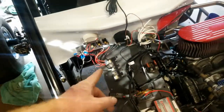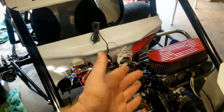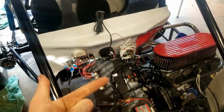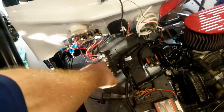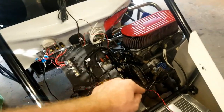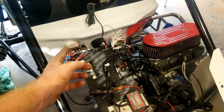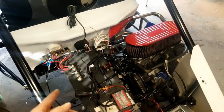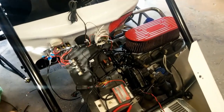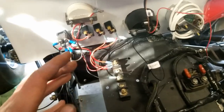If I lose everything — if I lose the motor and all my gauges go out — I either lost my main power or my main ground, and the quickest way to find it is right up here. It's either at the junction block or at the battery, or there's a cable burnt going to it. That makes it very simple to diagnose. If you have jumper wire after jumper wire and all these other wires, it could be impossible to figure out before a race.